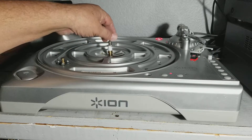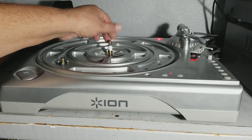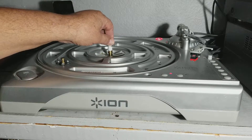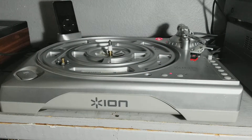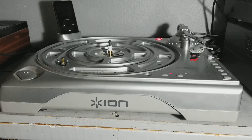This center peg — really what you would call it — is bearing-driven, and it's meant to spin, so it's okay if you put some Teflon tape here. What I did is I just took a little bit of Teflon tape and wrapped it around one time, just to get the platter to lift up just a hair — not a whole lot. And that lifts the platter up enough to stop the rubbing.